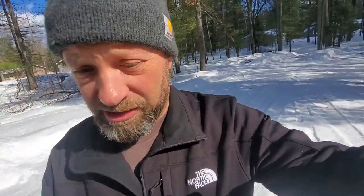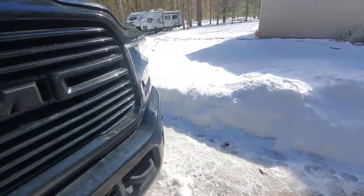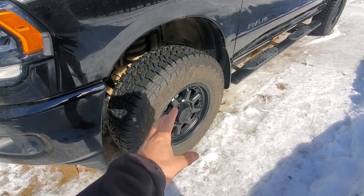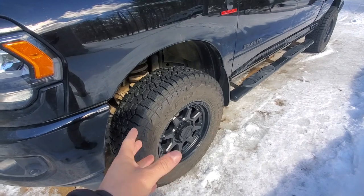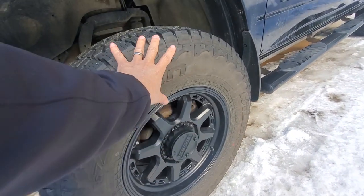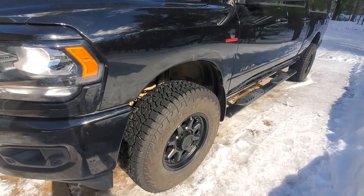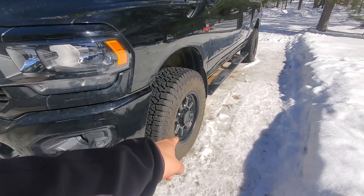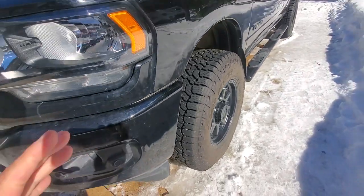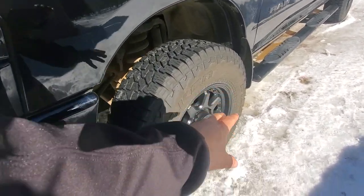Let's dive right into the variables. When you're about to buy a wheel, you're going to have your rim size - the diameter. Here we went from 20s to 18s. I wanted 18s because then I can air them down. We take this truck off-road all the time - it lives in the woods. With 18-inch wheels, I have so much sidewall that I can air this tire down and get a bigger footprint. With 20-inch wheels, you don't have that luxury - you can't really air them down as well and you don't have as much protection from rocks on the sidewalls. So I chose to go from 20s to 18-inch rims. You've got to figure out the diameter of the rim you want.